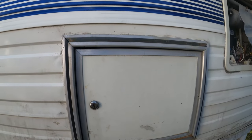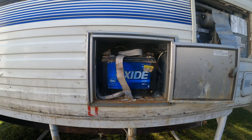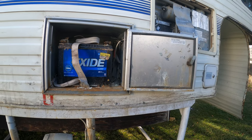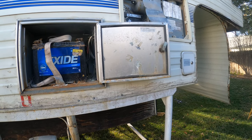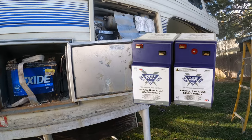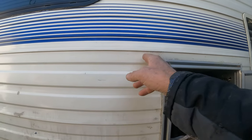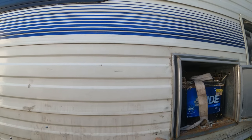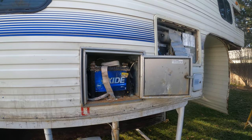In the battery compartment, I'm going to have to rebuild it and make it a little bit bigger than it is right now. I've got two 100-amp GC2 Battleborn batteries coming — they're in the 6-volt configuration but are 12-volt 100-amp batteries, just narrow and a little bit tall instead of long and wide. By making some minor modifications to the battery cabinet, I'm going to have to reframe it, make the port a little bigger, rewire everything, clean it up, and make the door a little bit bigger. We'll be modifying that battery compartment to take two Battleborn lithium batteries.